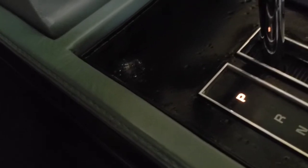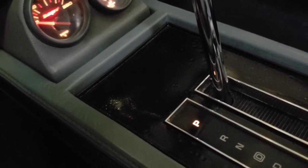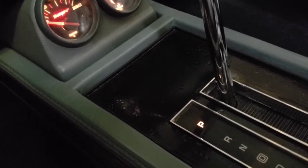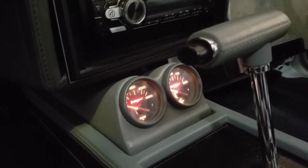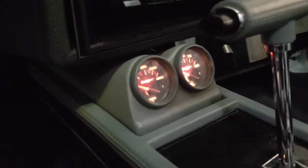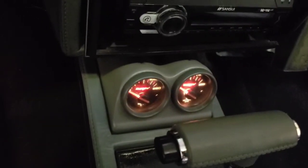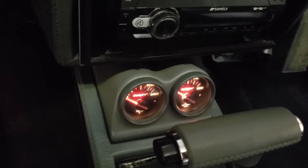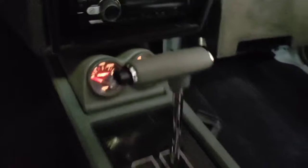The lights are wired into the wire that goes for the shifter lights. I'll show you what I'm talking about - turn those on and as you see your park lights come on up there. There's one wire that comes out of that console and goes up into the dash, so we spliced into that. Therefore we got gauge lights - bam - our gauges are lighting up now.